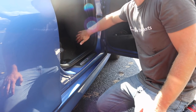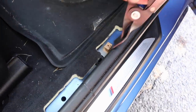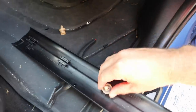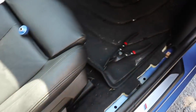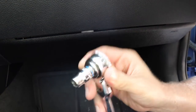We'll show you how to run this wire, then go through how to remove your wheel and put it back on. We need to get to a module under this kick plate, so just lift up on this trim very gently and pry it off. Once you pull this piece of trim off, the tabs will often get stuck, so just pry them out and slide them back into the grooves, then press it back into place when done. Next, take a 10-millimeter socket — under your glove box there are two 10-millimeter bolts, one on each side — and loosen those.